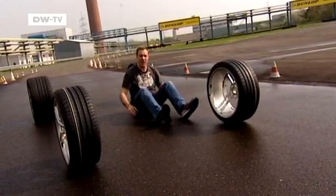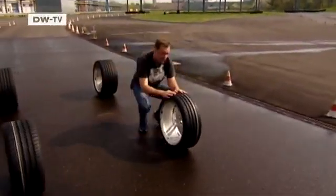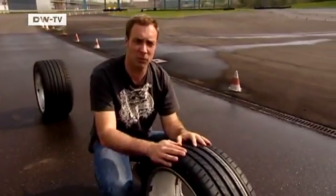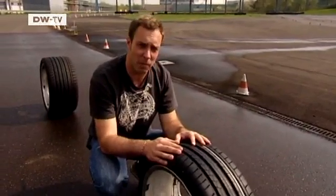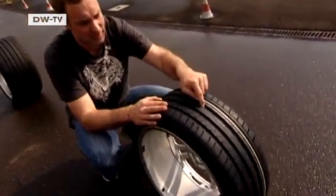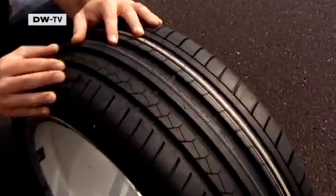Without the body, he can see the tire and its tread depth. By law, tires have to be replaced when the tread reaches 1.6 mm. When it comes to aquaplaning, 3 mm might not be enough. This black line shows when the tire is worn down — for us, far too little. We're going to try it with a new tire, so more water, guys.